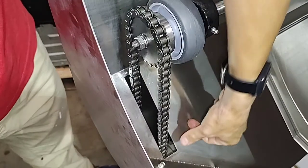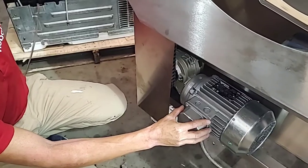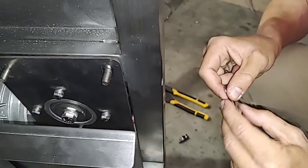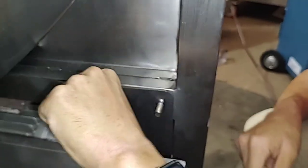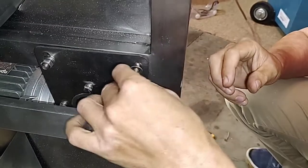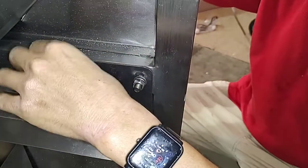The good tension allows about 4 to 7 millimeters of movement, and this is exactly what we have here. Right now our plate and our engine stay in the correct position, and all we need is to fix it from the other side of the plate. We will need to install the washer, the grover, and the nut — the same from this side. As long as we have good tension, we just need to secure it.